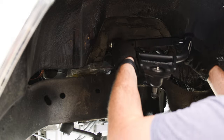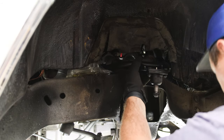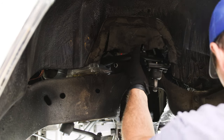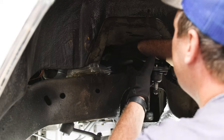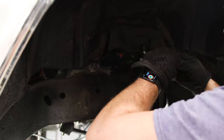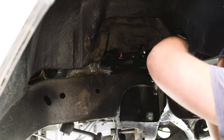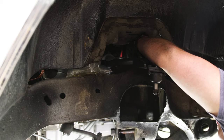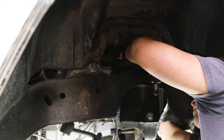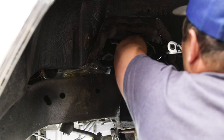Moving to the front of the car — we've got the upper control arms. These mount in the original location, so it's just a matter of disassembly of everything you had before. Since I've already done that, it's straight into putting these upper control arms in place. These already have ball joints and have additional caster built in, so we're going to get enhanced ride quality because the geometry is already corrected for a modern vehicle. They bolt in place just like the originals. I'm using the original hardware since these don't come with new bolts — they have special copper-colored fine-thread nuts on the back and the originals are fine.